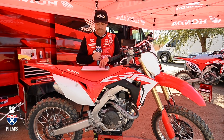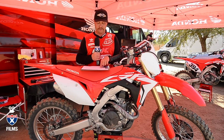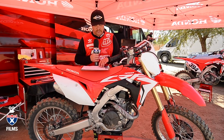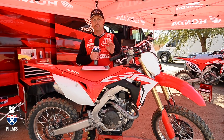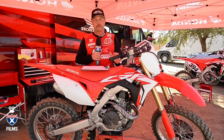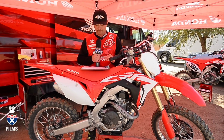Rebound, I went in. Honda recommends 8, Honda Media recommends 6, and I went to 5, so I slowed it down even more. Sag 107, as I mentioned. And that's going to do it for your suspension. I think you stick to those and that 107 sag, and kind of play around with some of those numbers where we were. You're going to be really happy with this stuff. It's plush. It handles big hits well. It's really, really good stuff.